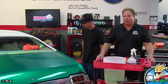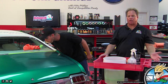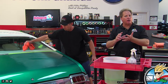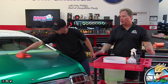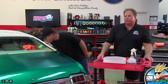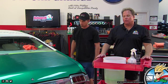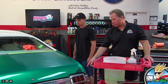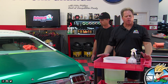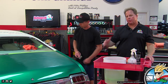I know there are a lot of guys out there who like to dry sand, and there are some techniques to help you do that. Like if you're machine sanding, have a terry cloth towel. After you sand a section, shove that disc on there, turn it on, and it cleans it and keeps it clean. So however you want to do it, I just prefer the safety of not breathing in urethane dust. That's all good. Also, avoiding the mess, because I can take a mop and clean that slurry up off the floor. Instead of pushing it around with a broom and vacuum, it's all going to get in the air. So your choice. Okay.